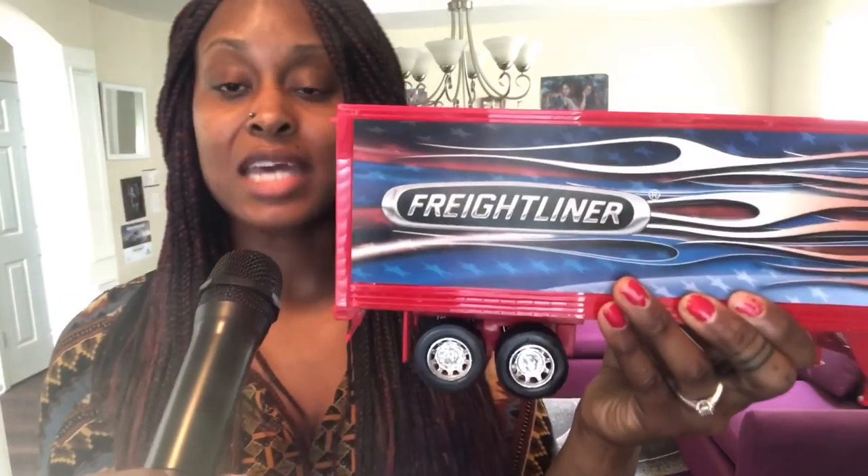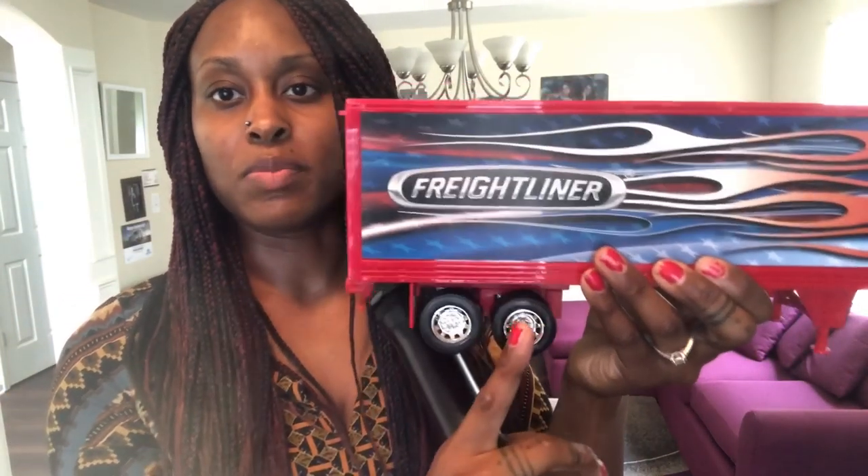So let's get back to the question. His exact words were why do you have to slide these wheels forward, but he really meant backwards. Because a lot of times when you go to these receivers and they tell you, 'We're giving you door 50, back into door 50,' they'll also say 'slide your tandems back.' That means these two sets of wheels, once you push the button or pull that rod and release the pins, you get in your truck, put it in drive, and these wheels are going to go all the way to the back. If you wanted them to go forward, you'd put your truck in reverse and back up.